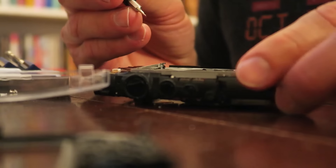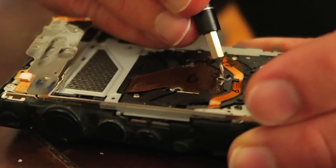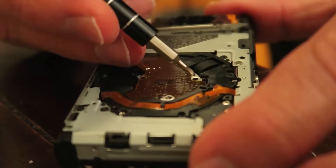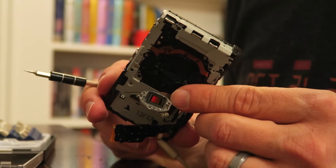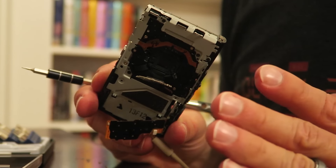There is glue that was holding the screws from turning, and because there's glue in there it's also holding the sensor in place. I'm trying to get the glue out so I can get the sensor out — probably the best way would be with a heat gun, which I don't have. Number one, you're probably going to ruin a camera if you do this. Number two, if you think you're going to be able to save the camera, be super careful about this sensor because that is the heart of the camera. If it gets scratched or messed up, the camera is pretty much trash at that point.